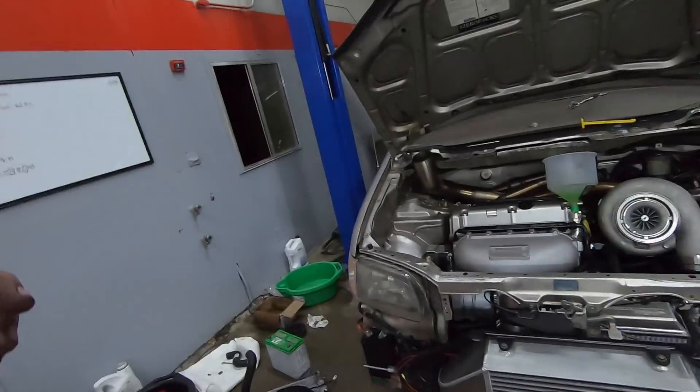I'm super pumped guys — Radicee's back up and going. There's still a whole bunch of little things needed before it's ready for race week. I have the whole weekend plus Monday to get this done. I need to get the headlights working, we need a horn — all this stuff is required for Rocky Mountain Race Week. All the lights need to work and I need to go through the car. I need to start getting spare parts. I need to make a cover for the fuel cell — yes, we are going to make a cover to separate it from the driver compartment. I also want to make a quick catch can from the valve cover to help catch oil.